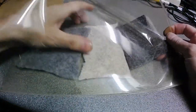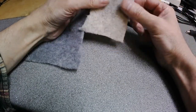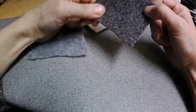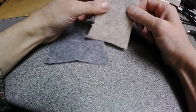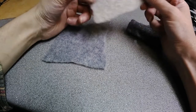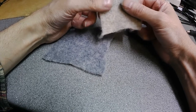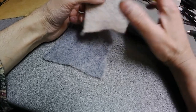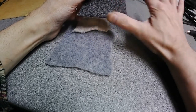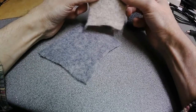So this is the main difference. It's nice to work with this carpet. It's a bit different technology when you're carpeting than with the non-stretchable one. If light passes through the carpet, it means it's quite thin and never covers all the tiles smoothly. If we're using this carpet, we can cover some surface imperfections. With this also, but less.